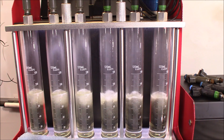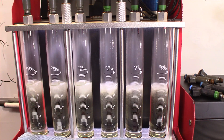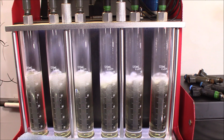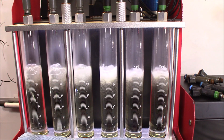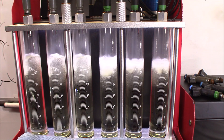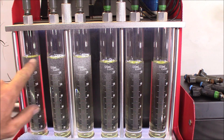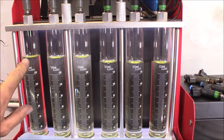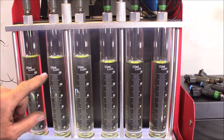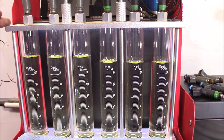These are doing a much better job of atomization. As you can see, these first three did use more fuel, so they do have a higher capacity. But you get much better atomization, so this is going to get you the best performance and gas mileage. These are better for your high performance engines, especially when you start adding mods.